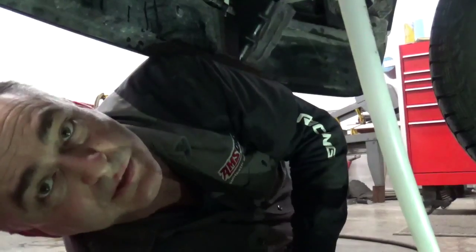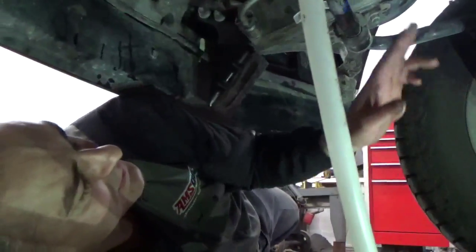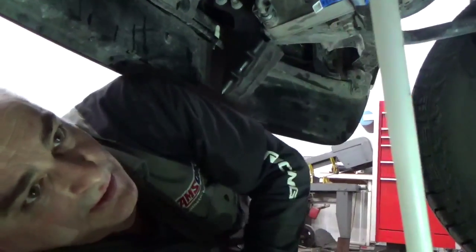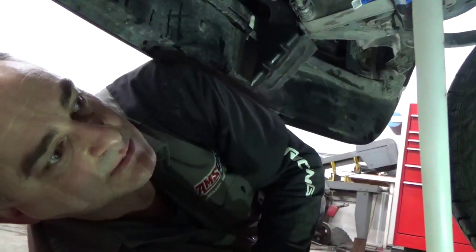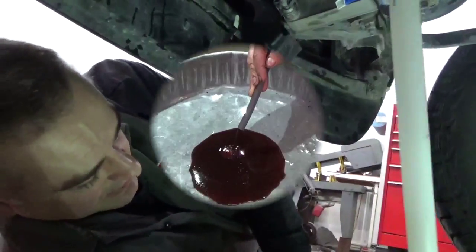And we're going to add fluid to the transmission. We're going to put in probably about 2.5 gallons, and then we'll start it up. And that new fluid will push out the old fluid out of the torque converter and also out of this cooler. Once we get a good color change, we'll stop and button things up and recheck the fluid level. So we'll get started with that and be back with you.